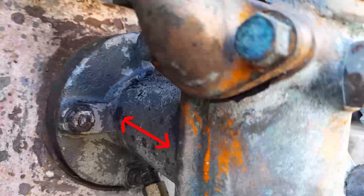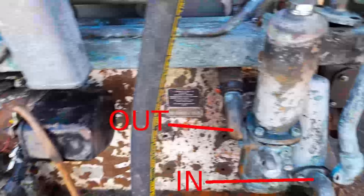There's a reciprocating piston which travels in and out inside that chamber that you can see there. If we look at the overall picture of the pump, you can see that the water comes in from that lower pipe and goes out at the upper pipe. The lower pipe is normally connected to the oil cooler, but I've disconnected that just for the simplicity of this video.